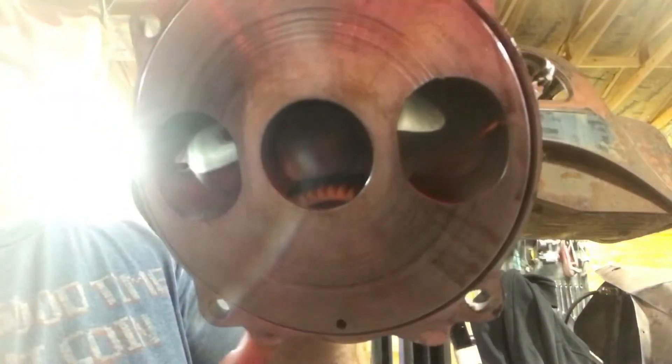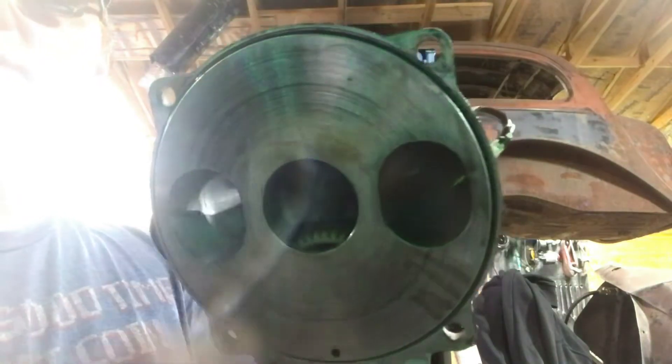There's also a little plastic gear in here that drives your oil pump. Thanks for watching — hopefully you learned something tonight on the Sea-Doo jet boat. This is obviously not how I'd ideally do this — the best approach is to pull the motor out, split the case, and make sure everything's out. But with the camera setup I have, we could get inside there. There was no debris found, we got all the shavings out with the vacuum, and the camera showed the rotary valve face and connecting rod area all clean. I feel pretty confident, and I'm just hoping to get back on the water this summer. Thanks for watching, have a good night.